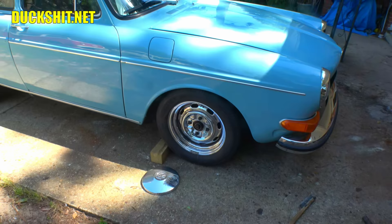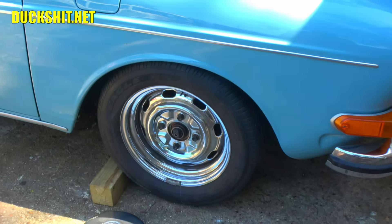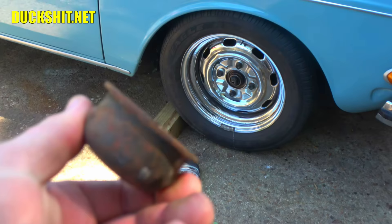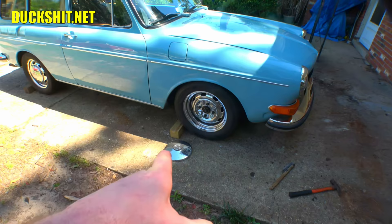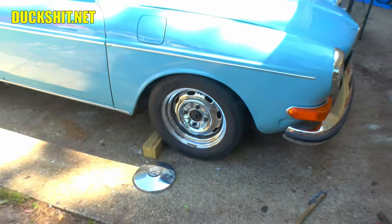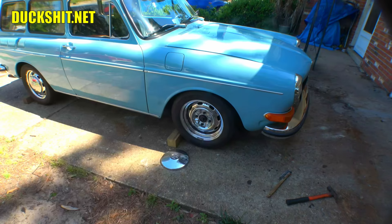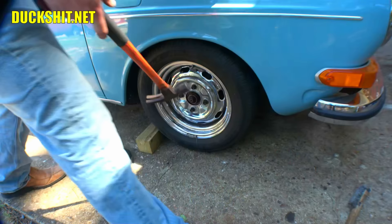We're back. When I popped the hubcap cover off last night and got started, I didn't notice the wheel bearing cover was missing. Looking inside, there's very minimal dust — the hubcap kept it clean. I went out in the yard and found another cap; it's a little rusty but I'll get it cleaned up and installed. I don't see any reason to repack those bearings — the grease didn't look contaminated with grit. I got the right side lowered this morning, so everything is situated.